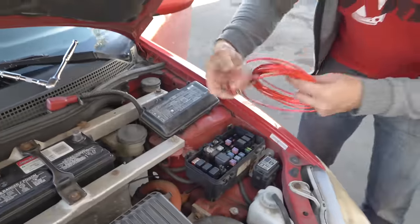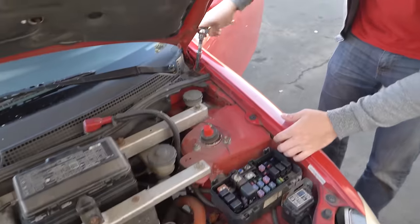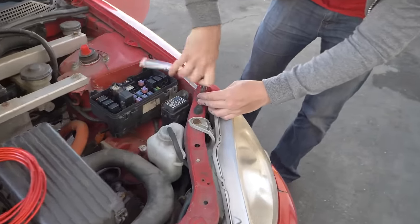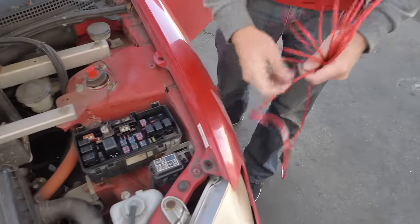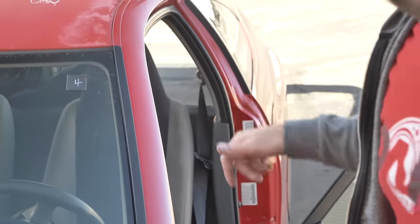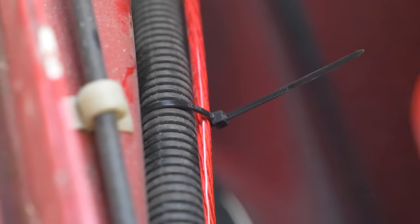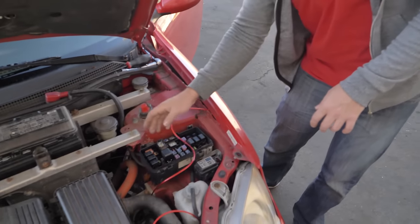This step is a little interesting — it'll be different for everybody's car, but we're going to have to find a way to get this wire through the firewall, or bulkhead, and get it into the passenger compartment safely. First step: take off your positive lead. You could run it here, but then you have to worry about this wire splitting and potentially getting shorted out. Start from the fuse box area, snake it along where the wire loom goes along the car and the fender, then have it run down by the base of the kickboard. Finally, run it along the side of the door frame, up the back, and we've poked it all the way to where we want the subwoofer to be. We've got the wire going through the rubber waterproof sealant — wrap it up along the wiring harness, zip tie it so it does not move, snake it out through here, and connect it to the fuse box.